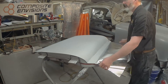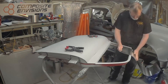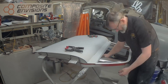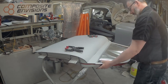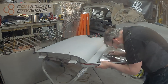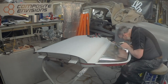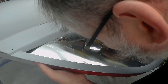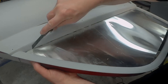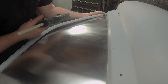We're getting moving with the flanging. I decided in this video to give you a full look at the process of flanging one of these molds, because I haven't done that in the past — the only other full look was on the trunk video. I'm now exclusively using aluminum flashing material; you find it in the roofing section of your home center. We're all a little pressed for time right now, but I'm putting a lot of time into this flanging and I want these molds to be very nice.